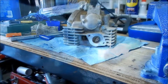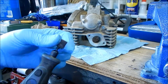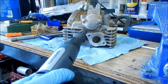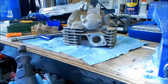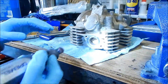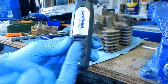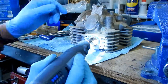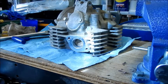Here we go - we're gonna do some port and polish. I've got the most coarse roll on my Dremel right here. We're using the Dremel because the port is tiny, and we're using the biggest roll and it already takes up like half the opening, so it'll go through fast. We probably want to keep it at middle RPM so we don't eat up the roll so fast. We're gonna grind in a circular motion.